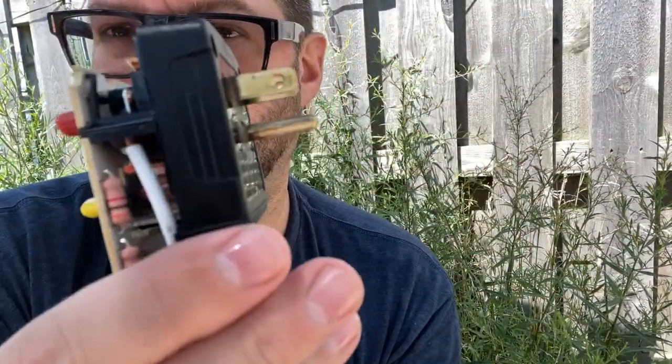One of the other things I noticed was that the contacts on the plug were rusted, because I have mine plugged outside into a regular extension cord. So I used a little bit of sandpaper and a pair of pliers to clean those off and tested them with a multimeter.